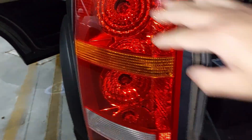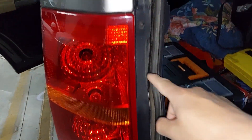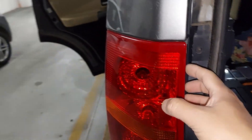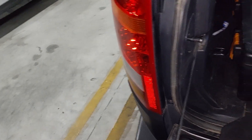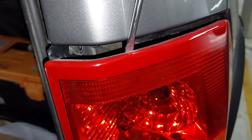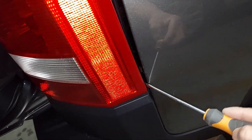I need to take both of the rear lights out. There's one Phillips head screw here and another one there. Once I undo those it will just pop out. It has got two plugs on it so I had to first pry it out a bit. There's another one just underneath — push that out and it pops out.